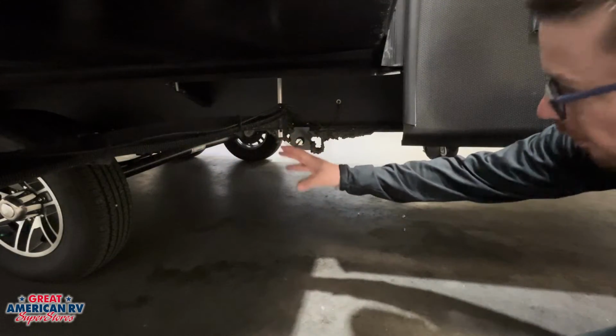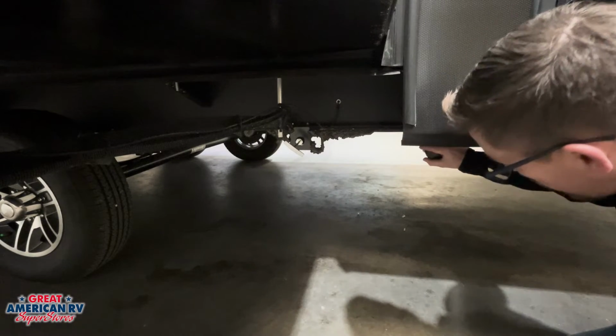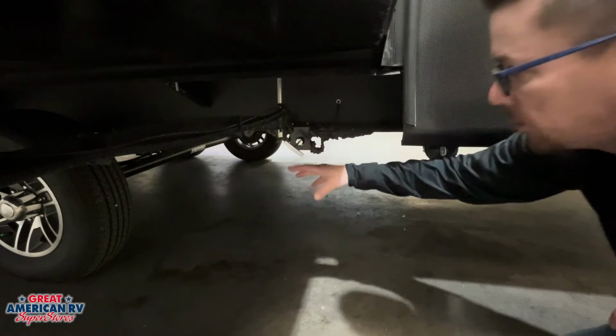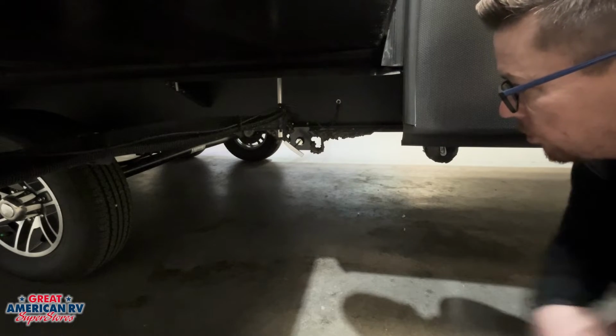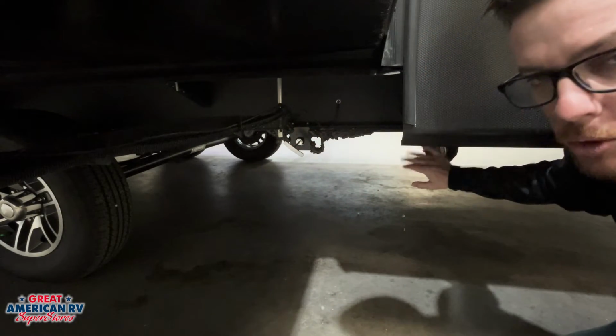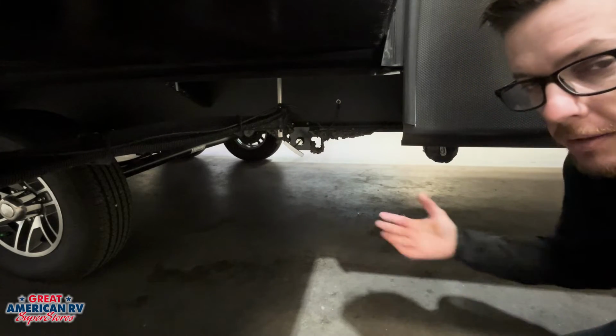We'll notice under our slide out more towards the rear, we have a second connection for our sewer hose. This is a secondary tank for our gray tank. This would be for our galley area or kitchen where our kitchen sink drains into, and same thing, we can leave that open all the time. As long as we have that hose hooked up, we can shut that valve off when we don't, and it can accumulate until you're ready to dump.